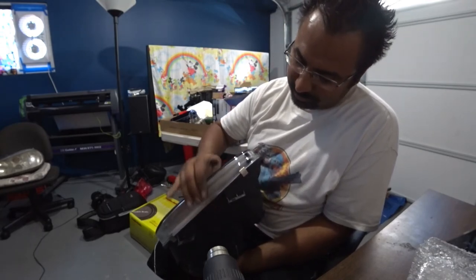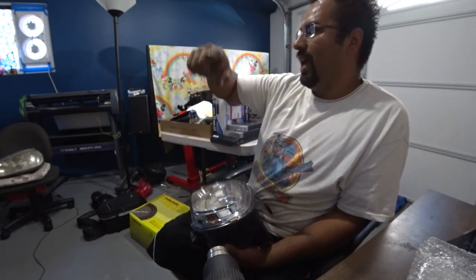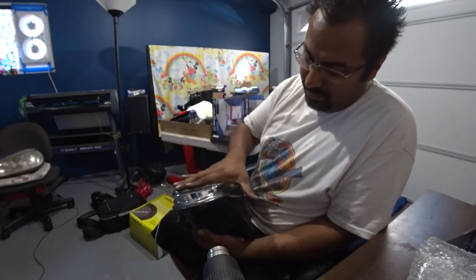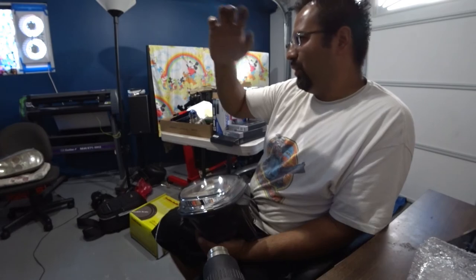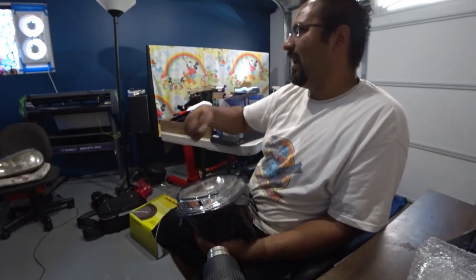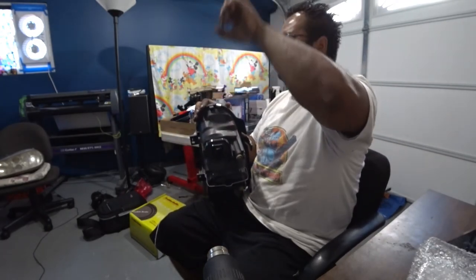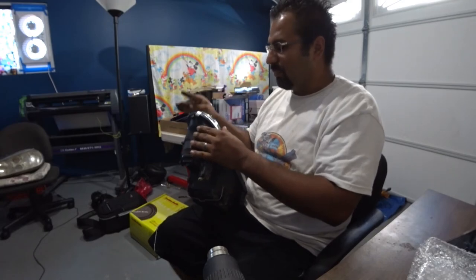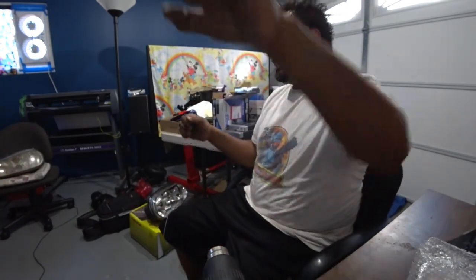Number one. What you want to do is, once you disconnect the cable on the handbrake side and on the actual caliper side, at the beginning inside the cabin, you put your new cable on, get your new cable all the way and tie it up with some electrical tape really, really nicely, and then coat it with some grease or bearing grease. That will pretty much let it slide through easily.